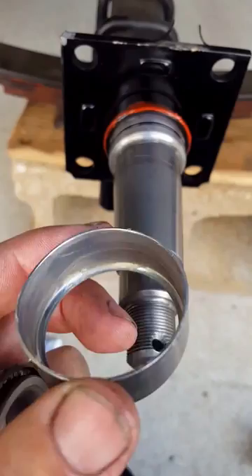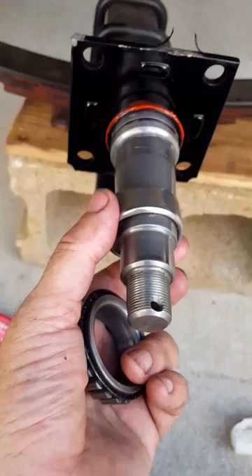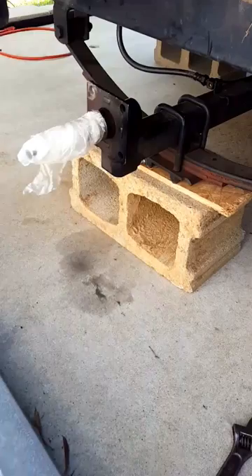I'm showing this hub again. What I've done is I'm putting the wear ring sleeve, which is stainless steel, right here. You can see how it slides on — see what it looks like on the inside. It just goes on a 1-3/8 spindle. This is for the DB 35 system that goes back here, where I put a brake rotor and a hub assembly — that's where the calipers go.